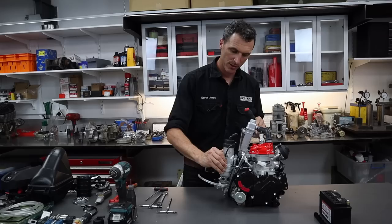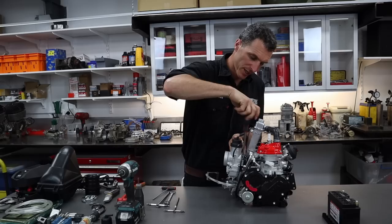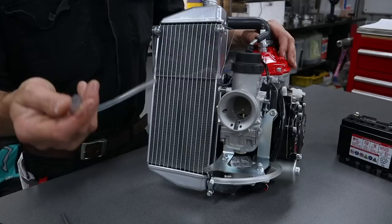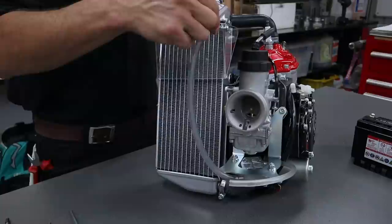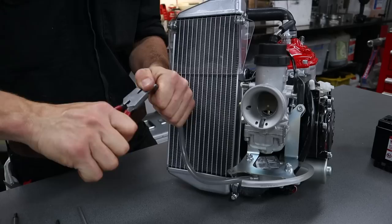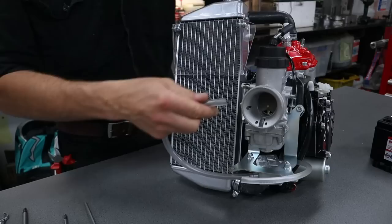The carburetor is nice and simple — that just goes straight into the rubber mounting block and then grab your 7mm or phillips head and do that up. Rotax gives us some fuel line here but it's pretty tight and hard to get on and off. What I like to do is get a piece of normal six millimeter diameter fuel line, throw that on there, and then get the circlip pliers, put them down in the side of the tube and work it around a bit and that will flare the tube out a bit so it goes on to the carburetor piece of cake.